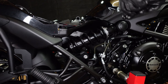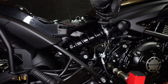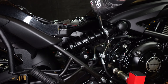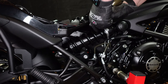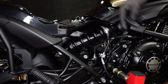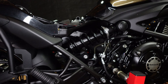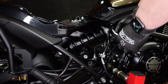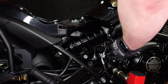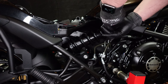To loosen or to make your suspension softer, put the spanner in so that it's in one of the grooves and turn it clockwise or downwards to soften the suspension. If you want it set harder, then it's the reverse: get it locked into a groove and then turn it anti-clockwise or upwards.